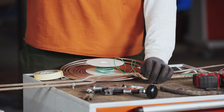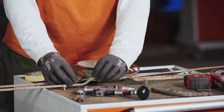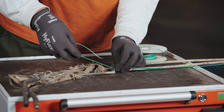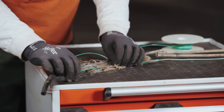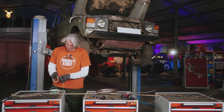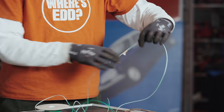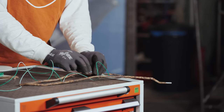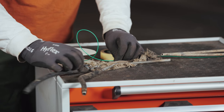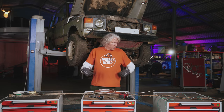There's a strange little part underneath the car that seems to be there for no reason. I've got one on both sides, which is kind of strange. I'll accommodate it for now just in case, but I suspect I'll find a way of avoiding it. I run the wire all the way to where the pipes kink up into the engine bay and connect to the manifold — marking that point. Then I do the same on the other side. They turn out to be pretty much exactly the same length, which is encouraging. I won't have to worry about which pipe is which until I start connecting them.